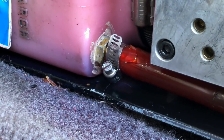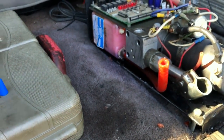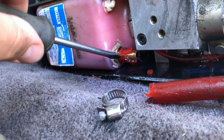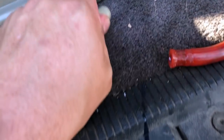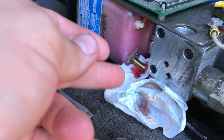The stupid hose cracked again. I was trying to clean up some of the garbage underneath there and it cracked. So I'm going to take it back off, cut it again, and be really, really careful not to touch this. You can see that hose is just disintegrating — I think it has reached the end of its service life. I just thought I'm going to pull one of these caps off my magnet stick — that'll cork that thing off. That should fit right over the hose barb there.